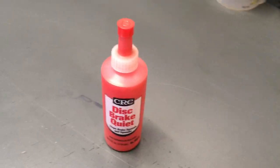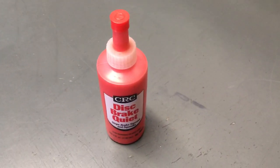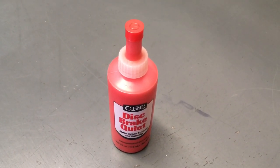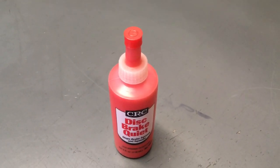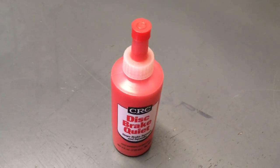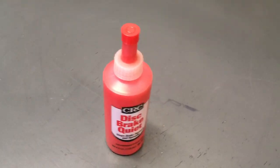Let's get the wheels off, have a look at these pads, see if we can do some basic checks and find any other problems first. I don't think there will be any problems because we've been over this pretty well, and as you can see I'm consistent — the other vehicle I drive does it as well. Maybe because it's dry and I drive smooth and don't use the brakes enough, they've glazed over a bit. With the right materials it shouldn't happen, but let's have a look.